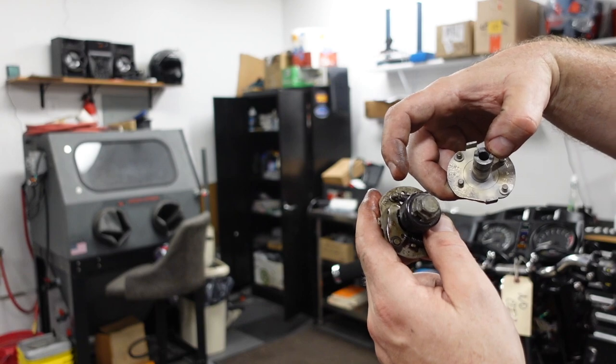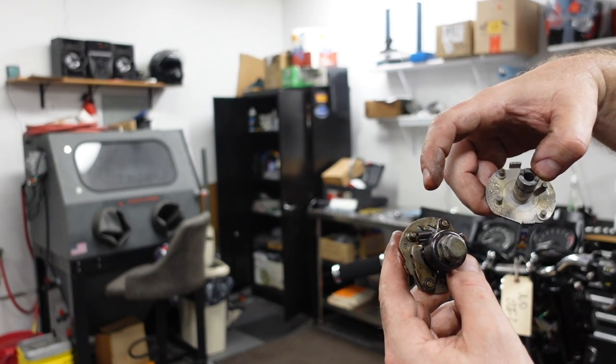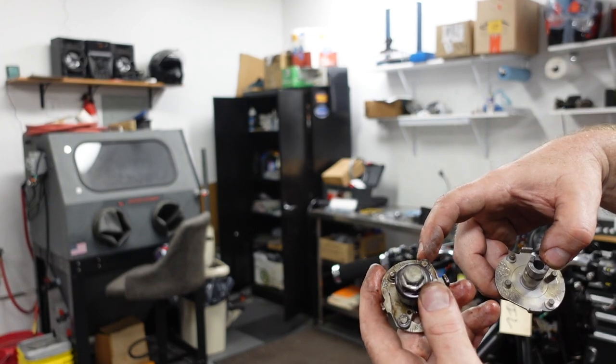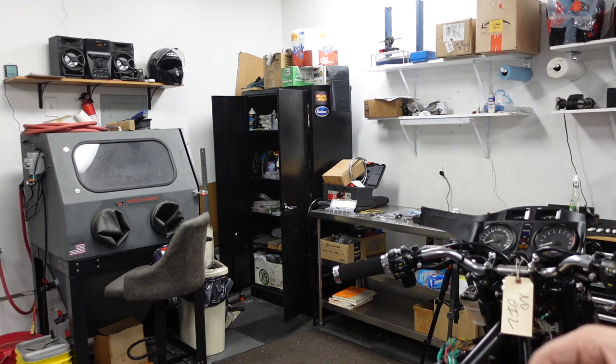This is the 1-4, there's a T, F. T is top dead center, F is fire, and over here is the high speed advance. So like when these go out, this doesn't have the same marks on it. So I have two other KZ1000 engines, a 77 and a 78, and I robbed one from one of them. And I'll have to find a good one somewhere.